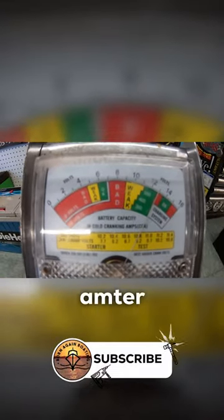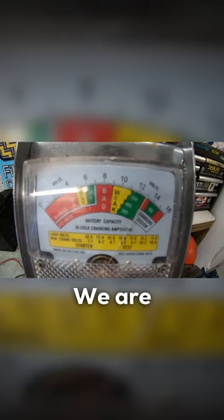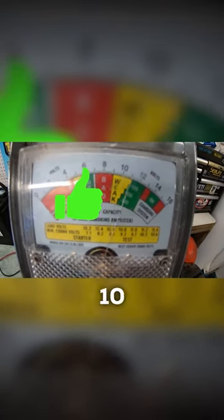These just put a huge amperage on the battery and let you see if the battery holds up while under that load. We are looking to make sure that the battery voltage doesn't drop to less than 9.5, or really 10 volts.